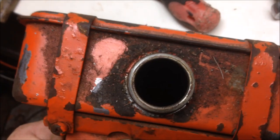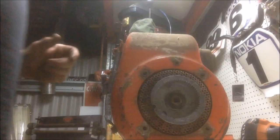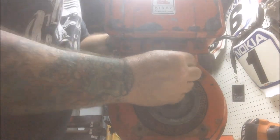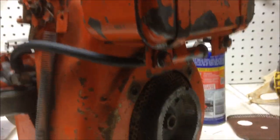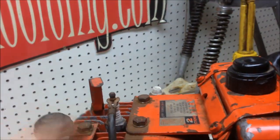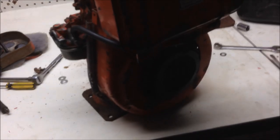It's full of scunge and oily fuel — it smells like death. All righty, fuel tank is cleaned out. There's a bit of gunk in that; the fuel tank was completely blocked. I've got my fuel hose on, I've got my plug back in, and we're ready to go. What I want to do is clamp it to the bench here so it doesn't move around when it starts up, and we'll fire it up right now. All righty, we're clamped on. Let's set this camera up and fire this thing — very first time, no trickery involved.